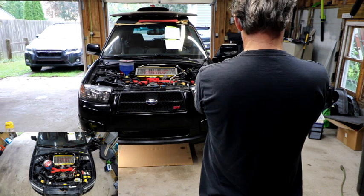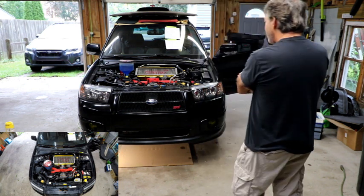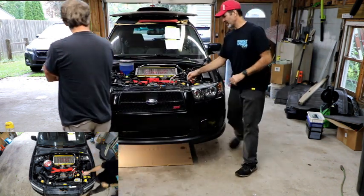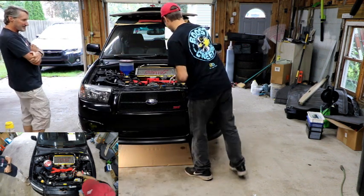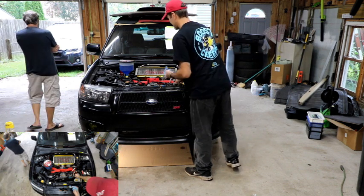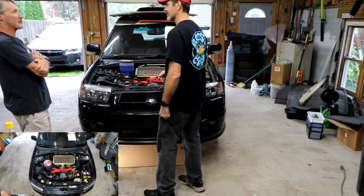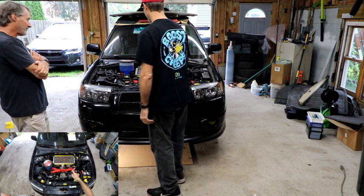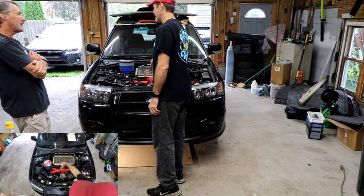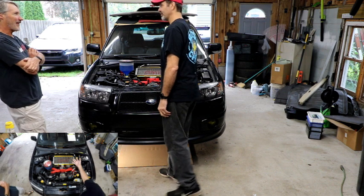My cruise light's flashing because the fuel pump is disconnected. That should have pulled my oil pressure up and I'm going to check this one more time. When I do mine like this, I do it without plugs and crank it 20 seconds at a time until I get oil pressure — the light goes off first. I've got the Duffy one hooked up right up here, and another one hooked up in the back. When I get pressure in the back, I know it's already going through the turbo. They both popped off already — good.